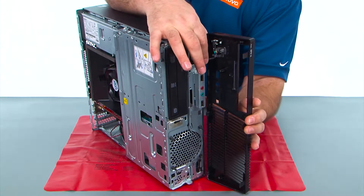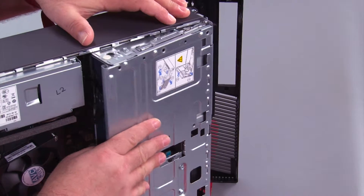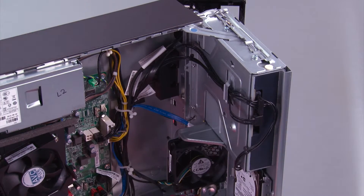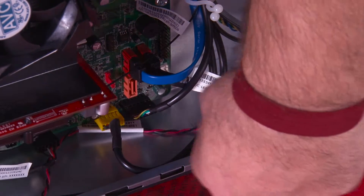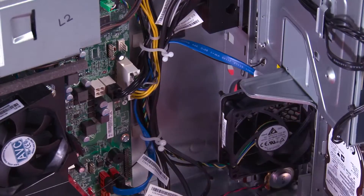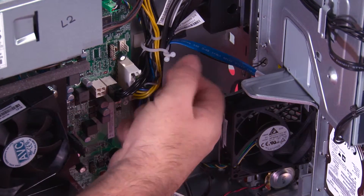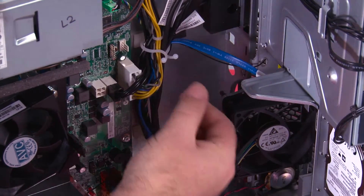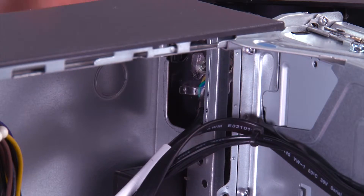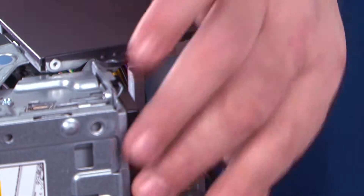We still have a cable here that goes inside. Now we need to open the drive bay assembly — just open it until this latch pops and locks it open. Now we need to disconnect the power button cable from the system board. There are two clips that hold the cable in place; you twist to open the clips and then you can pull the cable out. Now just pull the front bezel away from the system and feed this cable through the hole in the chassis.